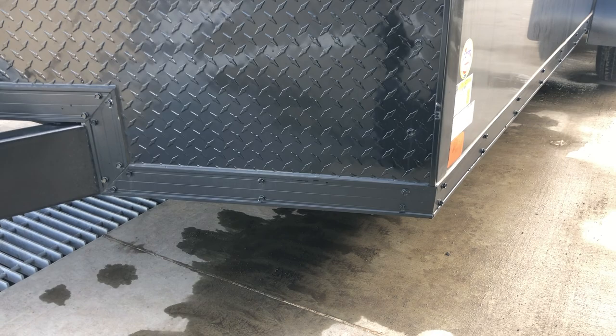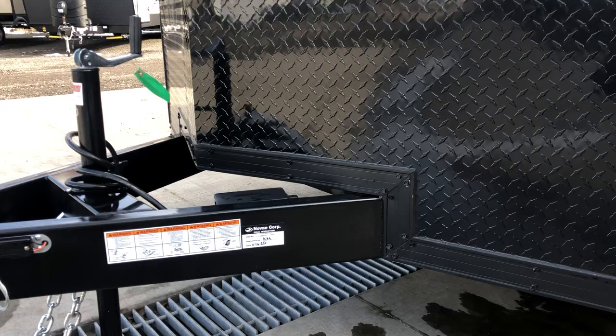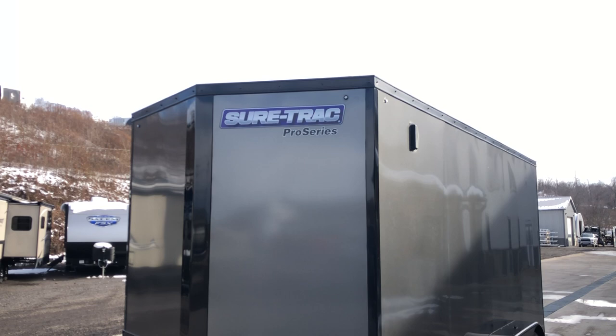If you do see a trailer that looks a little rippled, generally a lot of manufacturers every 16 or 24 inches on center would have a screw pattern — a lot cleaner look on these. Let's take a look at some of the other things that are unique on these. If you look, the trim on this is a three inch trim. Industry standard would be one inch, so it gives it a nice profile. You also notice it's got mitered corners where a lot of manufacturers will just do a butt cut at 90 degrees. And it is a fully trimmed stone guard — not every manufacturer does that.